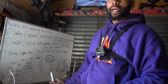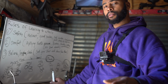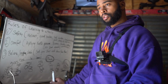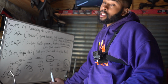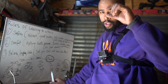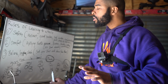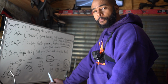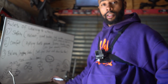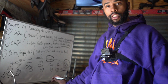I also went on YouTube and looked at a Southwest Texas Banshee dude, with the whole syncing of carbs. I honestly didn't have that at the time, so I just watched with my eyes to make sure they were level, and when I touched the throttle, both carbs were coming up and down at the same time. From there, I put my pipes on, and no lie, I went from not popping my bike one day to the next day getting 4, 5, 6, 7, 8 pops in one day.